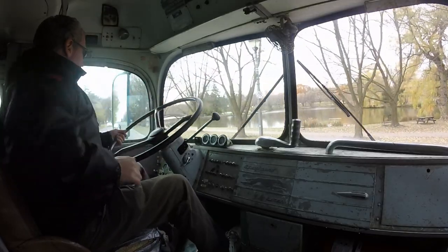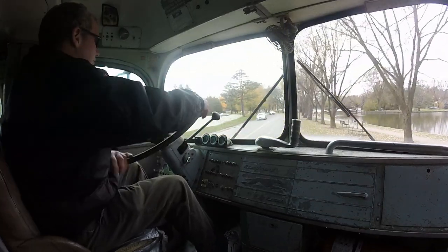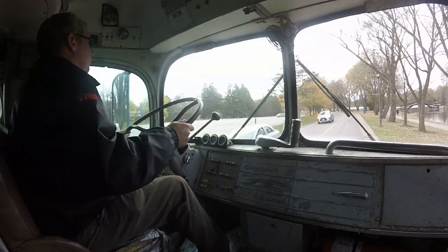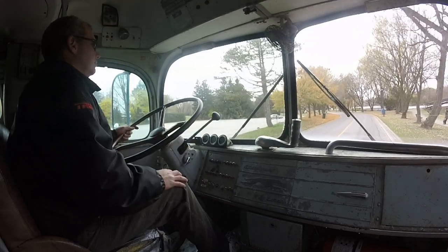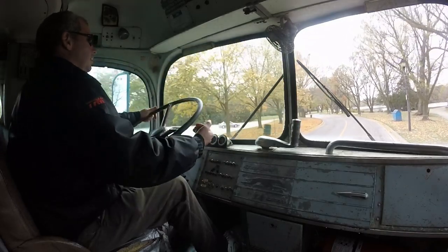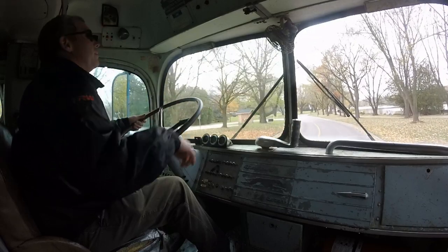That was fun. Only a slight casualty of my fingertip. As you can see, we weren't getting any voltage coming through the rectifier. We had 17 or 18 volts coming out of the generator directly, but it wasn't getting through the rectifier and going into the battery set. So we were only seeing battery voltage and it wasn't charging. After I changed the rectifier, it was working good again, and we're off to the races.